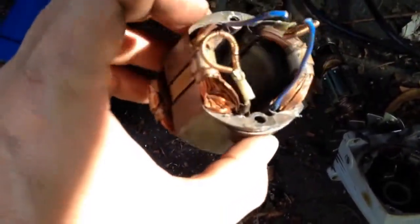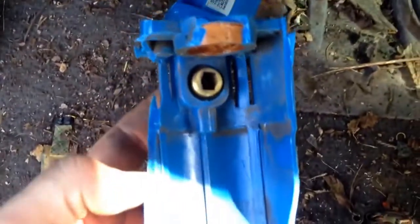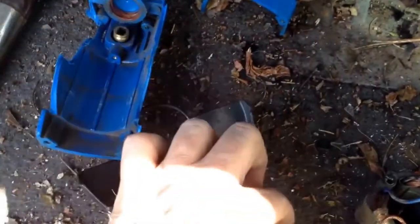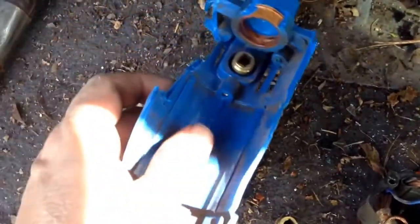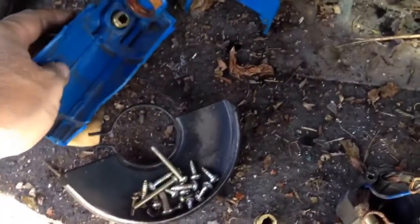We'll take that copper out — take this inside piece out and that comes out. We'll have a little bit of shred there. Molded into the plastic cap around this is a yellow brass motor contact. Just hold this down with a pair of pliers and take a flat head screwdriver and hammer and pop that out.